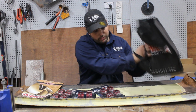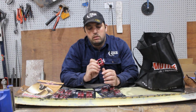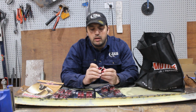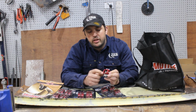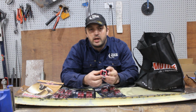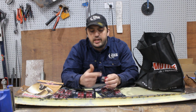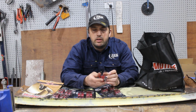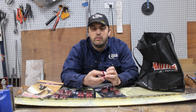Now, I've got butt welding clamps, a few boxes of them. These are expensive when you compare them to the ones you see on eBay, but these are an aluminium extrusion, so this bottom flange is dead straight. All the ones made of a piece of RHS that's cut down the middle, the bottoms bow out and don't quite hold the stuff straight. You've got to do a bit of fiddling with them to get it right.